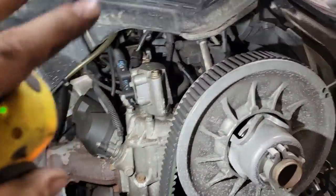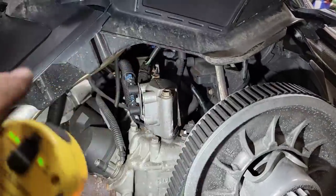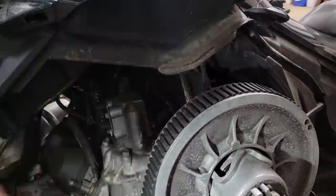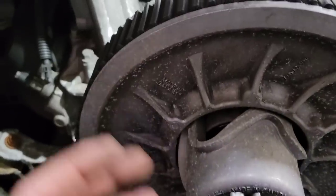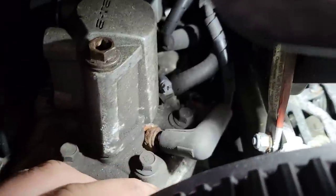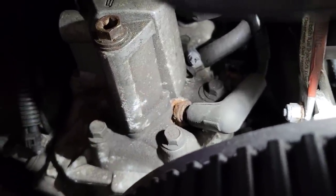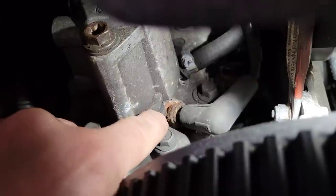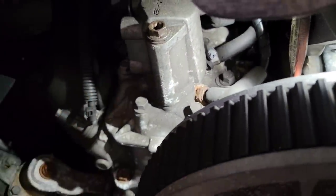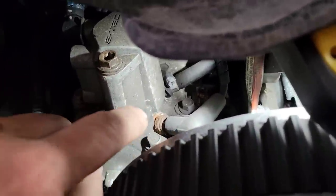Seeing as we're just doing a tune-up, this one's fuel-injected, so at least we don't have to pull any carburetors off and clean them up. We're just going to try and get at those spark plugs. Got the belt guard out of the way so we can see them — there's one there, one over there. That plug there looks like it's been in since Grace was a cowboy. I hope it comes out. But something's pretty good about these — they obviously don't foul plugs, because that has not been out in forever.